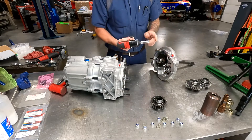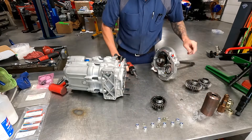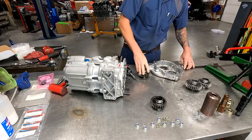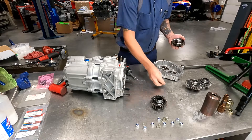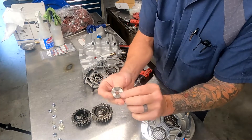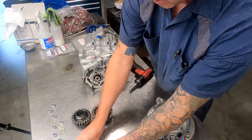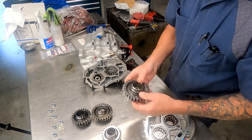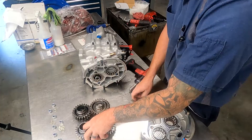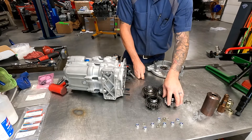Now this one is retained by a little lock nut and it's not super tight. I'll put just a little drop of red Loctite and just this little three-eighths gun should pull it off. So here is our — oh, and there's a washer. Make sure that you install this washer the right way. There's a bevel right here — that goes in towards the gear because there's a bevel in the gear and this holds it in, so make sure we don't put that in backwards. Now what we're installing is a 27/21. You can see that this gear is larger than this gear and this gear is smaller than this gear. So this is going to change our ratio fairly significantly to enable us to go faster because the larger gear is driving the smaller gear — it's an overdrive.